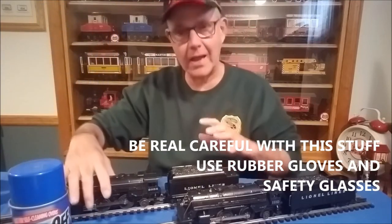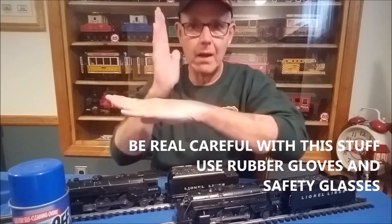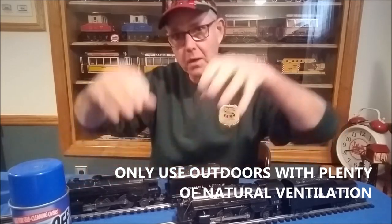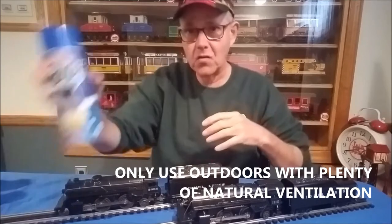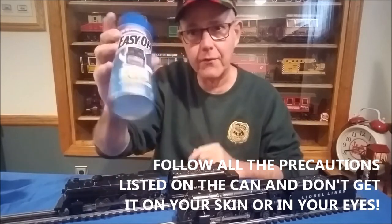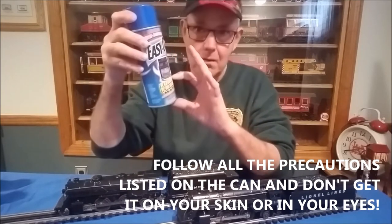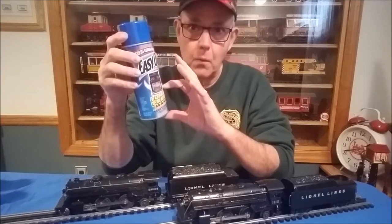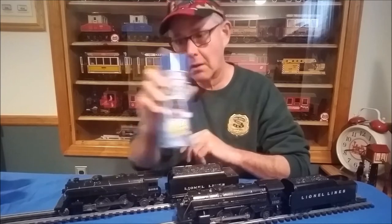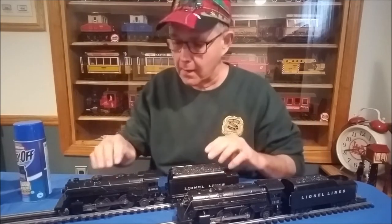Here's how you do it: make a stand — I made a T-stand out of a piece of plywood and a piece of five-quarter pine — that you can place the casting on once it's disassembled. You spray parallel to the ground, because if you spray down into a pan, you'll only get the first two-thirds of the product out of the can. The last third won't be usable. So spray either parallel to the ground or at a slight upward angle.